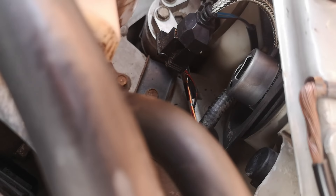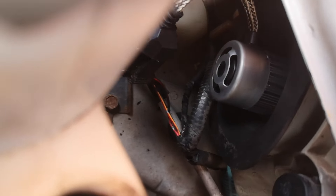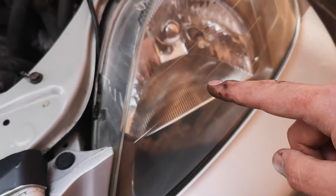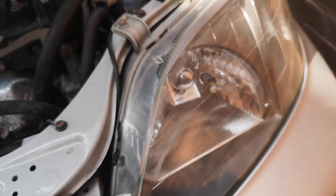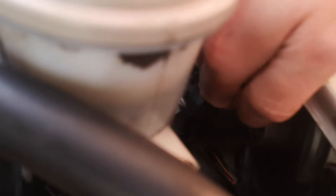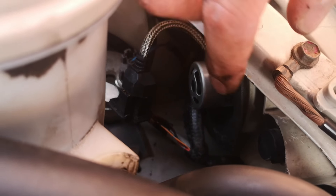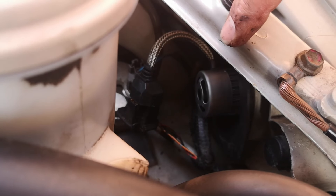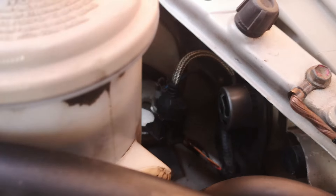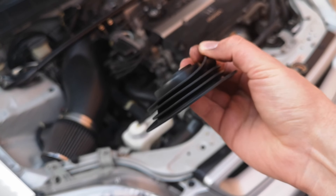As you can see, there's very very little room down here. I also had to try and get the sidelight in — you can see the rubber cap there just pushed into the headlight. The LED headlight is in place and rotated. I need to make sure it's rotated the right way around so that the high beam and low beam work correctly. The sidelight is just underneath the cup that holds the headlight, so that's really awkward to get to. Then you've got to try and angle in the headlight itself. Pushing this cap in was a nightmare — although it's the right size for these headlights, it's a bit too big. The rubber grommet has multiple layers and I had to physically force them into the headlight.